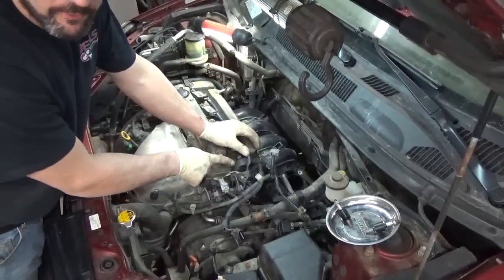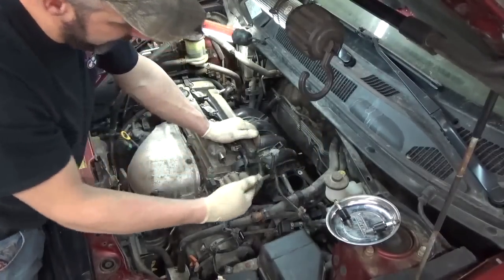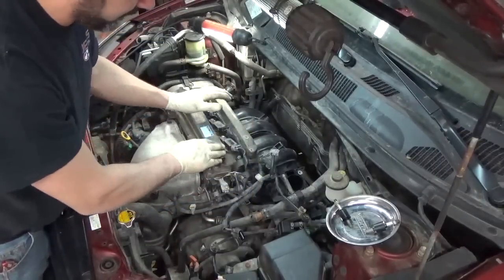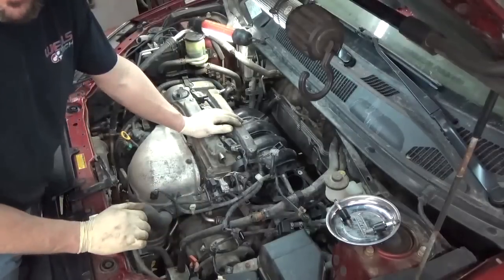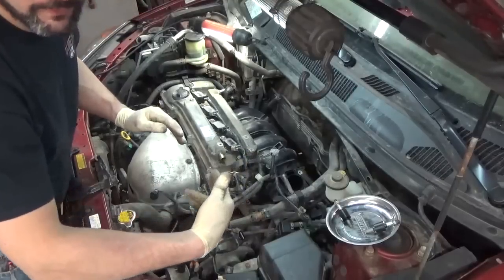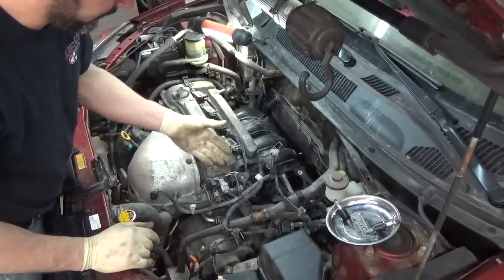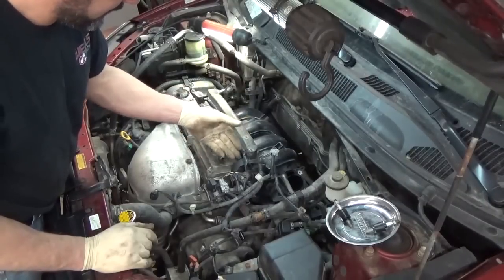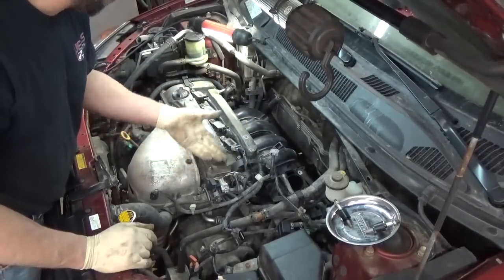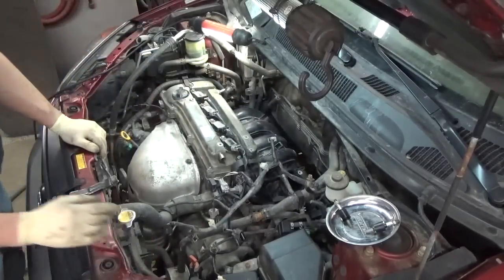There is a bolt on this wiring harness over here. It bolts right here on the valve cover. There's another one down on the bottom side. I left that one loose so I could manipulate it around and move the valve cover. So I did have to reach back through underneath and get that one. That was a little tough because I used a long extension right straight through to get to it, simply because all the hoses and everything are in the way now. But I didn't want to tighten it up initially and then try to move this and have it break. So I think it was a wiser thing to do. Yeah, let's keep rolling.